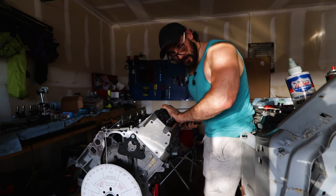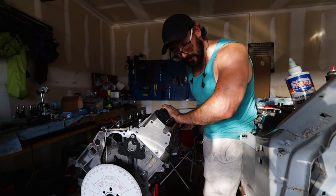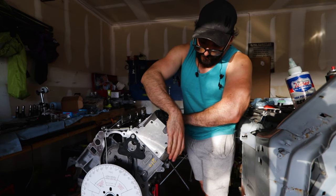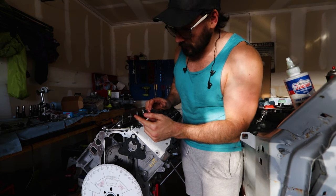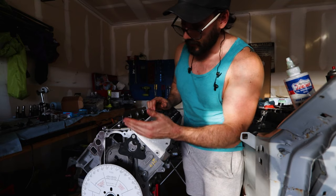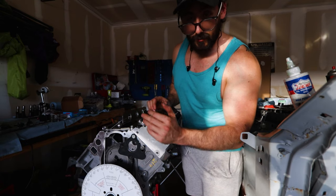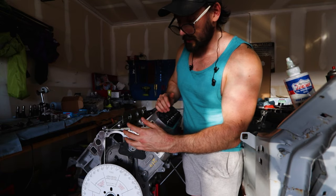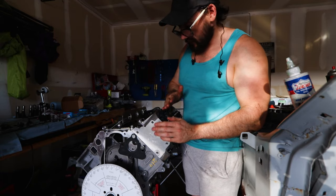For this part I'm not actually tightening it all the way down and I'm not using all the head bolts - just a couple to kind of secure it on there. I also put this plate here, which is basically from the timing cover - the cam retainer plate. We just had an extra one. You could use anything, you just need some sort of metal piece to mount the dial indicator to. That's why we have that there.